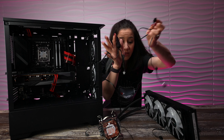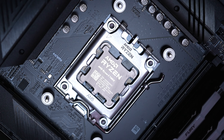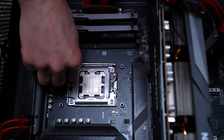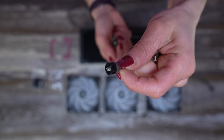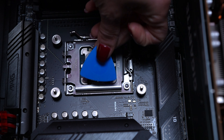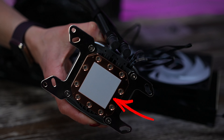Along with the additional ARGB cable attached to the bottom. So the AIO is out. Now we need our isopropyl alcohol to clean off the CPU — AMD Ryzen 5 7600X. Nice and squeaky clean. Now, because we already used the Deepcool AIO, these standoffs are identical to the ones that came in the new box. But for the sake of this tutorial, I'm going to take these off just to show you where the standoffs go. The black side goes directly onto the motherboard. Now, at this point, if you're going to use your own thermal paste, you would apply it to the CPU — it's important to get full coverage. But if you're going to use the pre-applied paste that came with the AIO, you can skip this step. Just be really careful not to touch or disturb the pre-applied paste.